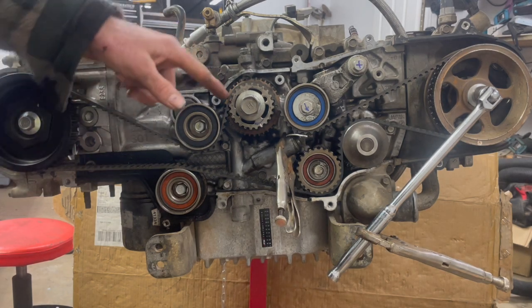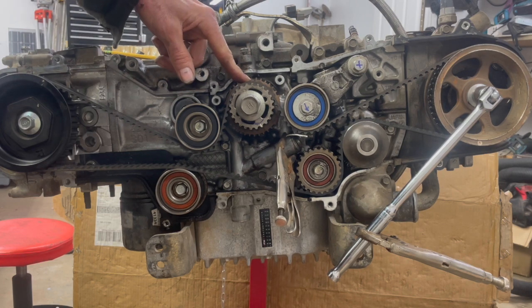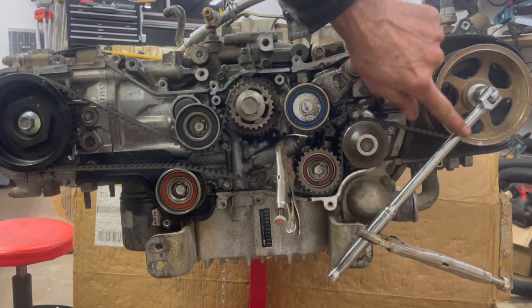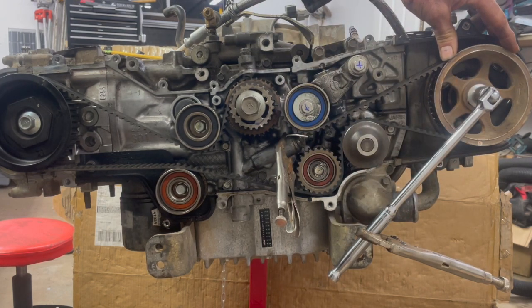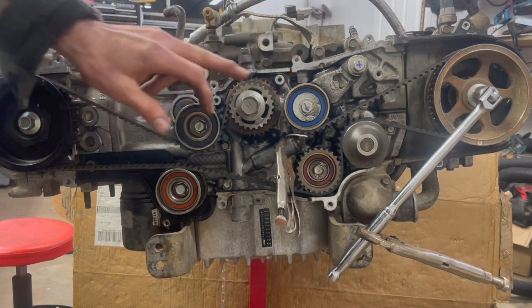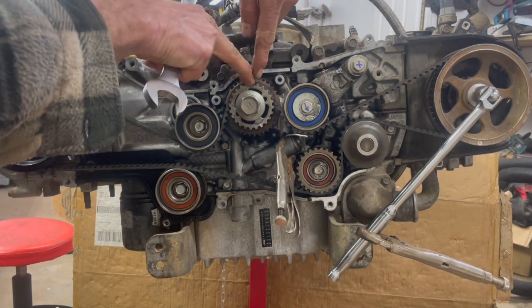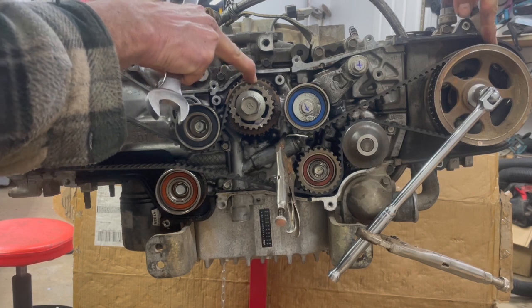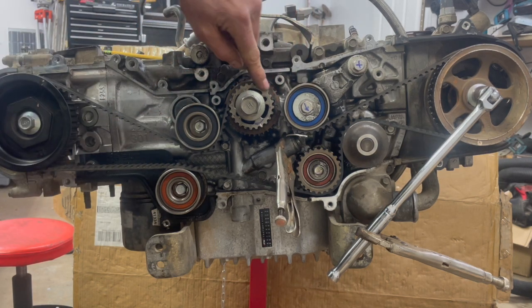I made a little test rig here to show how turning the EJ25 backwards causes the timing belt to slip. You can see right here this breaker bar attached to this cam to immobilize one cam. This is for the example of if you have a forward gear but you're pointed uphill, so the engine is holding it from rolling but it's also trying to turn the engine backwards. And that's when this thing slips. When you're going forward it doesn't cause any problem, but if it's turning the engine backwards, it tightens the section of cam belt here between these two and it lifts this tensioner up. And then the belt slips or the belt walks over one tooth.